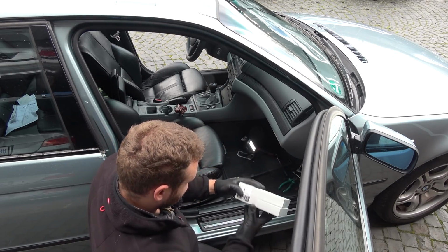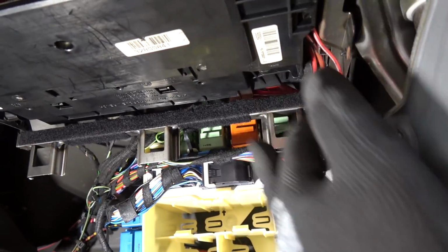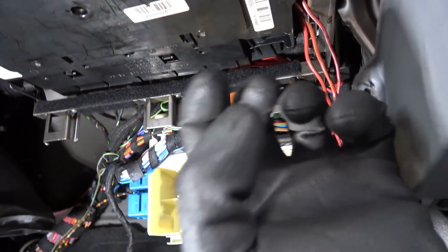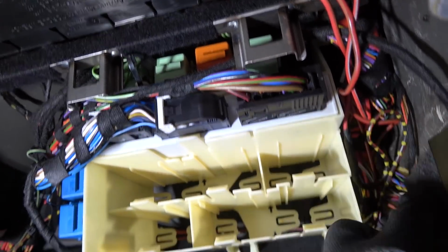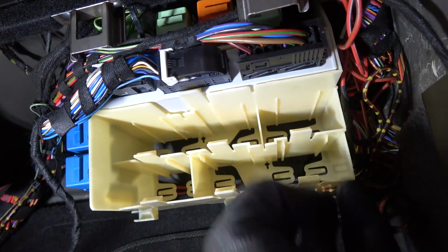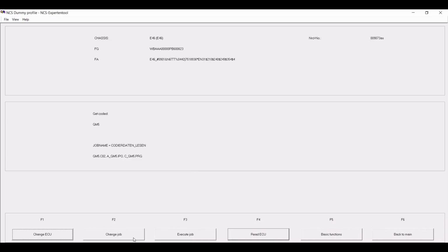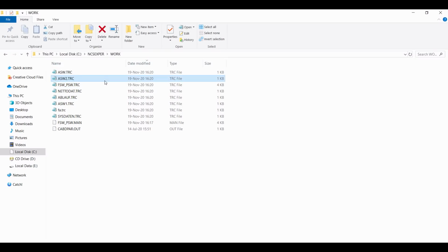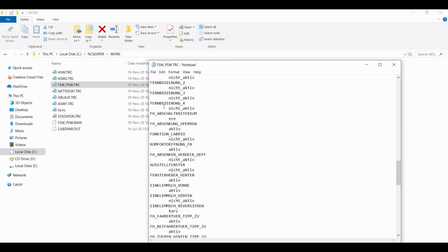So let's fire up the computer. The stupid GM module lives here, and this scaffolding is right in the way of pulling this out. So I need to lower this plastic, and I broke one of the clips on top that I'm going to replace with one from the donor car. Because all of this needs to drop a bit, and then I can slide it out. I used NCS Expert to copy data of the car from the old module and then pasted it on the new module, coded it to the car, and enabled the option for the rear power windows. If you're interested in more in-depth coding with NCS Expert, I'll leave a link in the description.